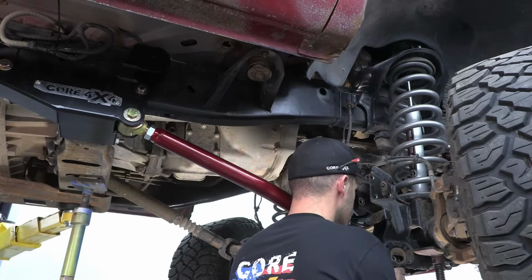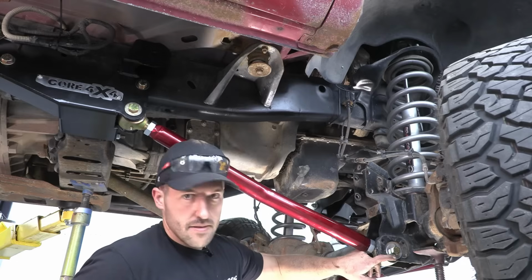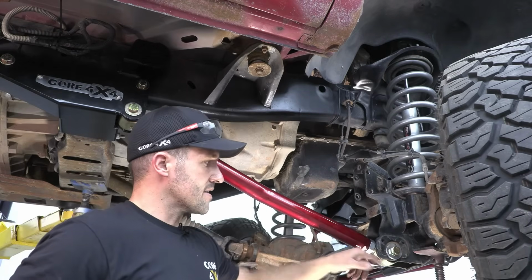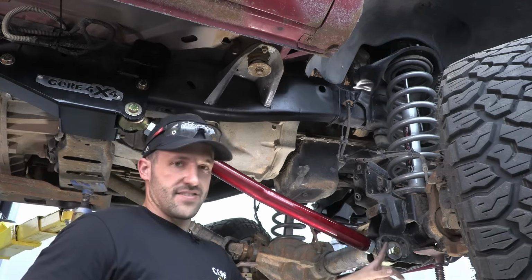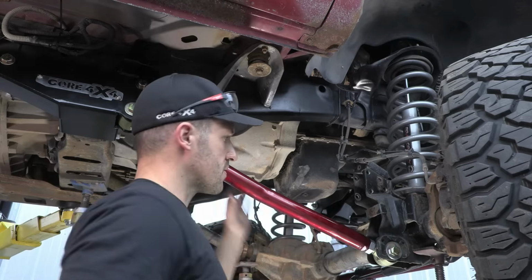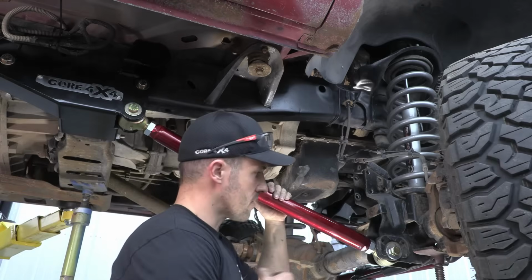We're not far off. Okay. The kit comes with these cam washers for your axle side. This is to center the joint and the bolt in your cam slots. Now, if you didn't have to cut out your cam bolts like we did, you're welcome to reuse these. We do have all the adjustment in the arms now, and these will actually spin to adjust even with the slight bend in them. The uppers won't, but the lowers will.